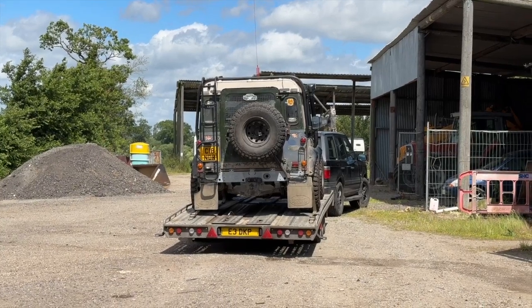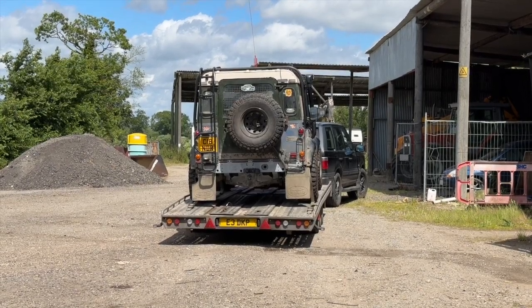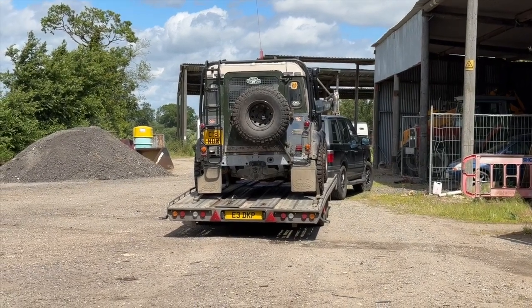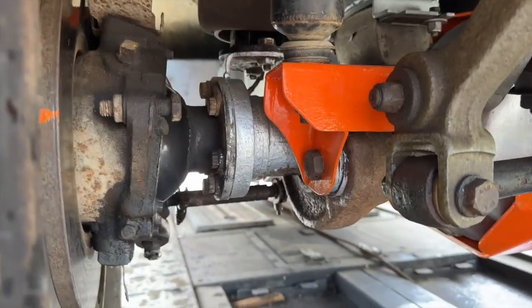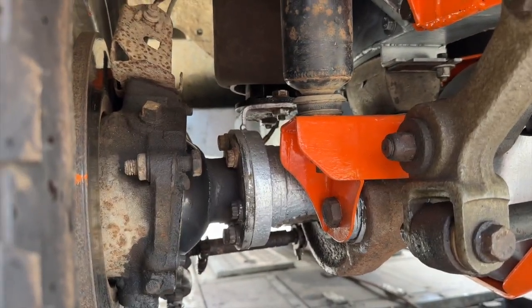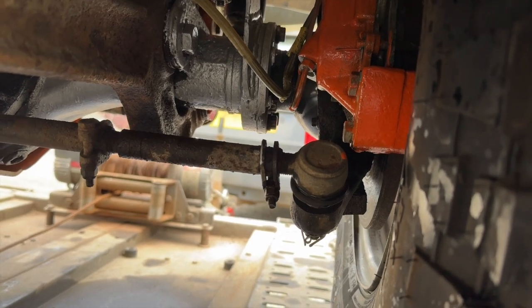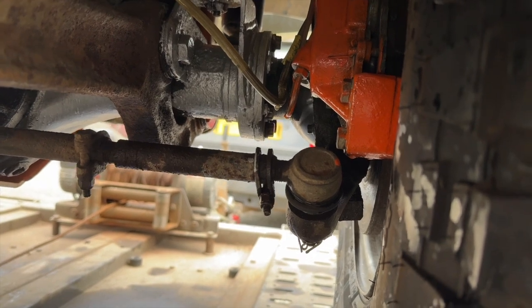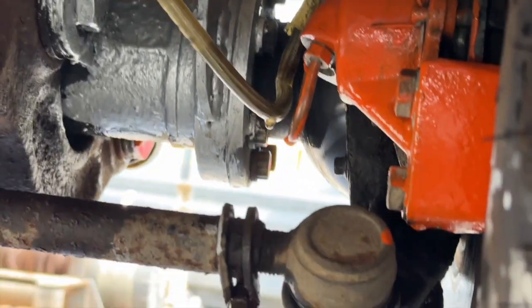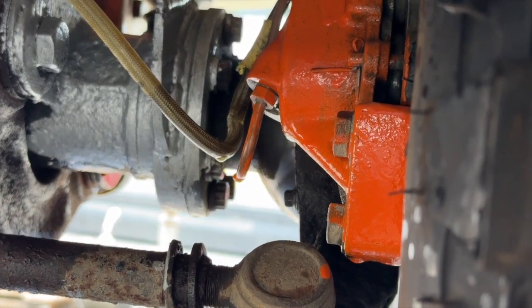What I need to do is get it off the trailer and inspect it. I did see they were getting close, but I thought every time they went down they all went out the way. But obviously there are some instances where they don't. So I've got to reevaluate the brake lines. You can see — it's all leaked all over the trailer on the way home. It's now on the bump stop so it can't get any lower. I'm undecided — unless it's getting trapped when it turns on lower suspension. But I always raise it up before I move it. You can see where it's pinched. I wonder whether when you turn it on locked with no suspension, whether that's getting caught.